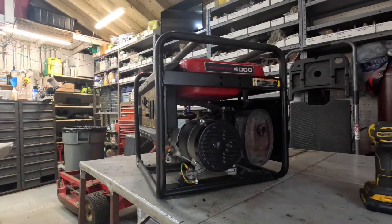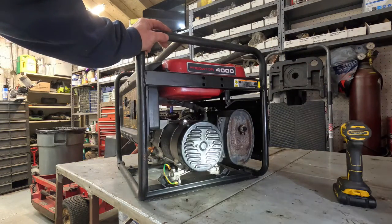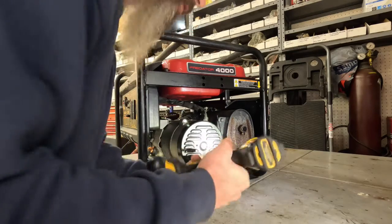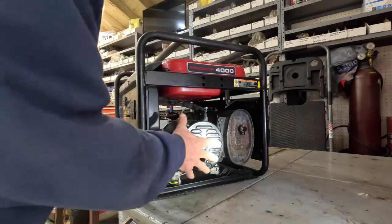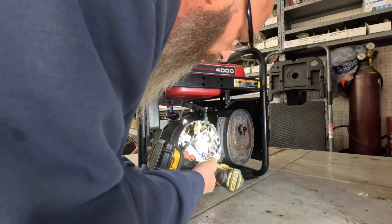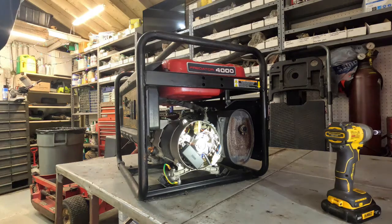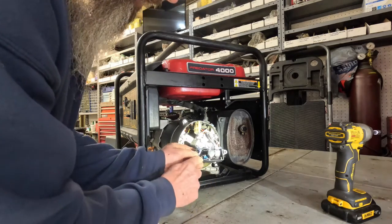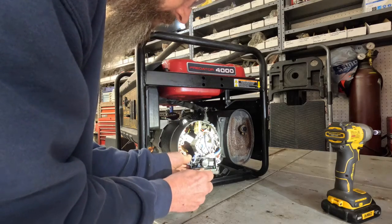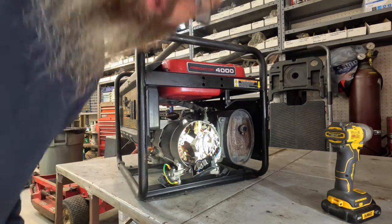So what we're going to do — can y'all see that? Put the old flashlight on it. We're going to pull this cover off. And there's the voltage regulator we just installed. I'll pull it loose so I can get behind it. Right there — that itty bitty screw. I'll take my itty bitty screwdriver, put it on there like that, and I'll just turn it clockwise while I monitor the voltmeter, and we're going to see if we can get something out of it.